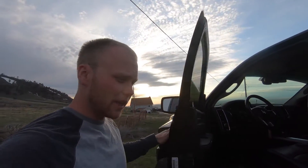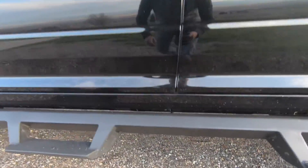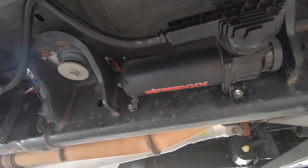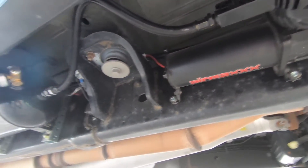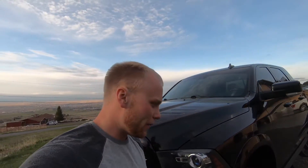While sitting in the truck it is a little bit loud but it only runs for a short period of time. Over on the passenger side — this is set at 150 PSI — you can hear it running and it is obviously fairly loud up close. It'll fill up to about 150 PSI and then when it drops below 100 it will automatically kick on.